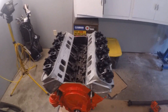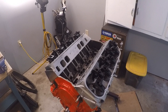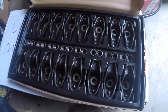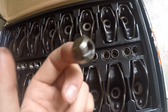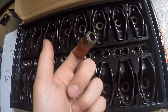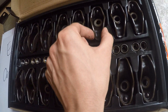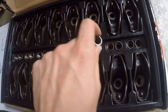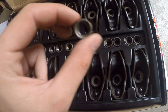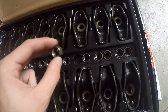If you guys have any questions, you can leave them in the comments — good luck. This process can seem intimidating at first, but it's a pretty easy process that just takes a little bit of time. Here is a factory set of big block Chevy rockers — your rocker is just like that with that little bearing down there in the bottom. These nuts obviously have no polylock, so just tighten until zero lash with your socket. When checking for zero lash, pull the socket wrench off because the weight of it will give you a false reading and make you think you're at zero lash when you've still got a little left to go. Make your adjustments, pull the wrench off, check for lash, then a half turn past.